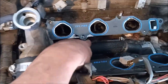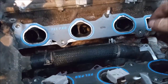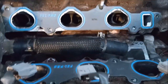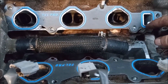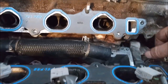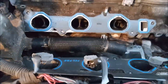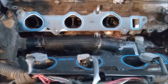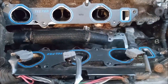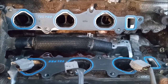You have a hose down here that goes between the coolant neck and the thermostat housing, and this hose can leak. You also have gaskets right here between the lower intake manifold and the heads, and these gaskets have coolant passages — they seal coolant passages that can also leak. You also have the thermostat housing itself where the thermostat is mounted. The outlet tube can leak, so you cannot be 100% certain of the leak source until you've dug all the way down underneath and identified it.